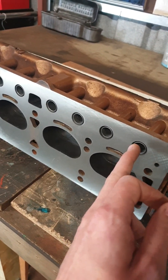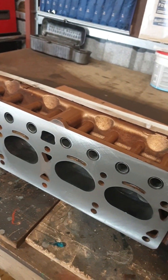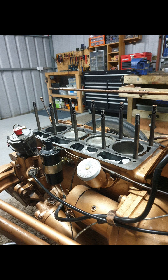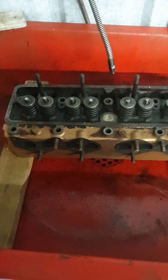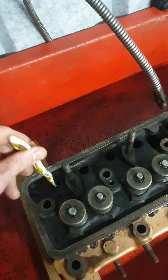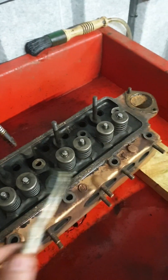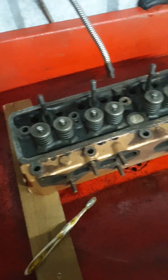Since this was probably covered in iron filings and still has a bit of oil in these push rod tubes, I'm going to put this into the parts cleaner and clean all of them out, then give everything a good blow out with an air gun. The handiest thing is to get a toothbrush and give it a good run up and down in those, and this will shoot out some diesel and kerosene mix.